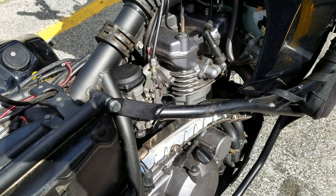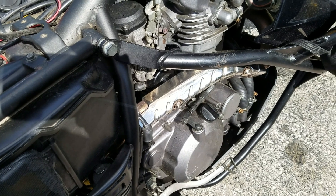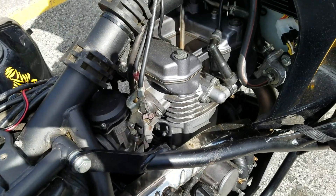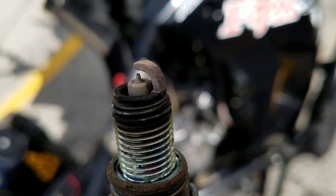Like I said, when I first did the carburetor kit it was running rich, and I think I damaged the plug. So I leaned it out and it was running real good after that.